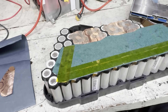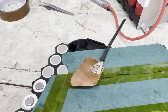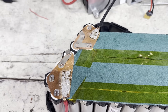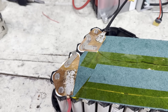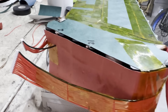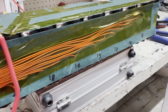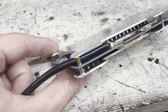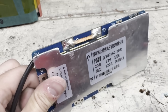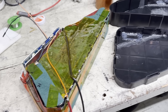The other side was pretty much the same, but I didn't need that really long connection. To connect the wires, I first soldered them to some copper and now I'm going to spot weld them on. After that, I soldered on the balance wires. You definitely have to get more creative when working on triangle packs versus rectangle packs. The BMS had two spots to solder the wires on, so I ended up doing this. After that, I added some smaller wires to connect to the charging port.